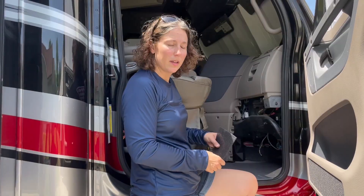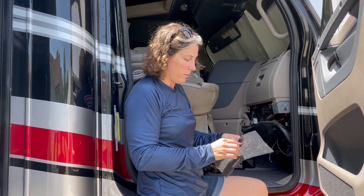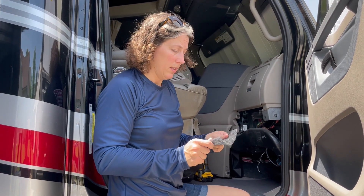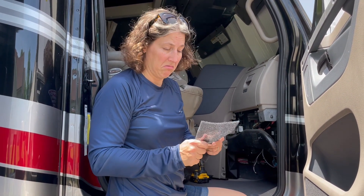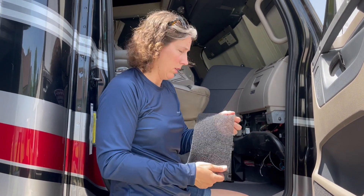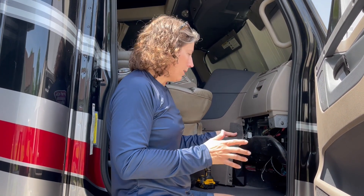I went ahead and washed this out. If for some reason it's torn or just can't be cleaned, these aren't very much money from Freightliner — I believe they're about five to ten dollars. So don't worry if you do happen to need to replace the whole thing instead of washing it out. But this is a washable filter and I didn't have any problems cleaning this one out — as you can see, it's really clean.